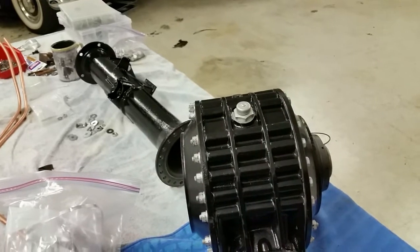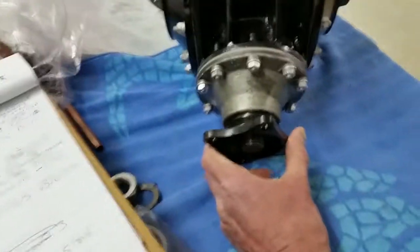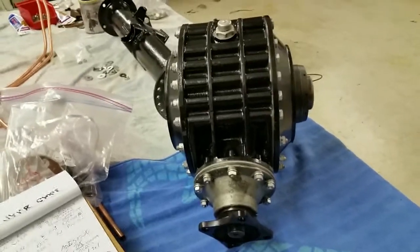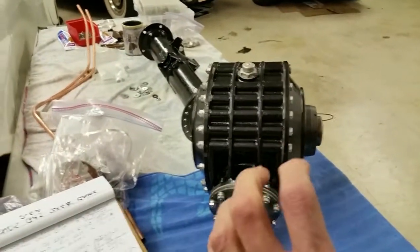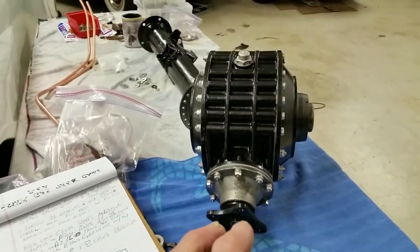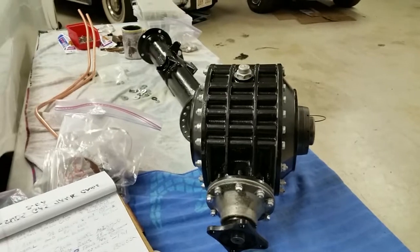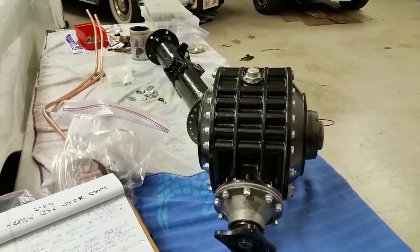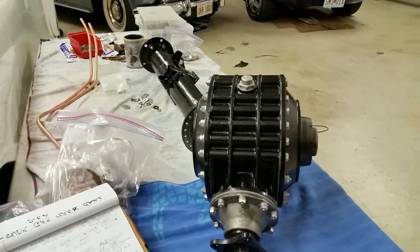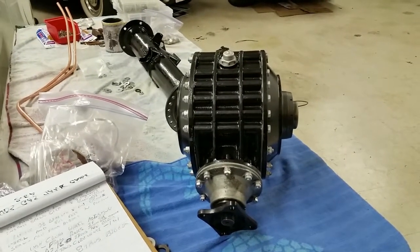Part 3 is coming up, but I would suggest that you grab this, which the drive shaft is connected to, put it in neutral, and jack it up. If you turn that and there is a clunk clunk, your bearings are about ready to go. After you rebuild it, it is just 8 thou, so it should not have very much movement in it at all. If your bearings go out in one of these, which is getting to be a problem with these Clouds, as I understand, differentials are getting harder and harder to come by and are getting quite expensive with the ones that are being blown out.